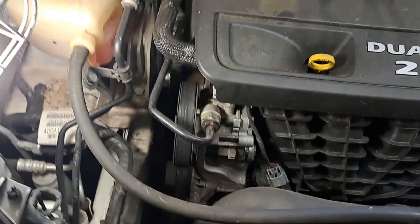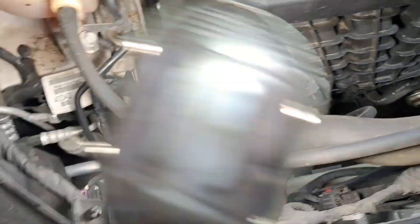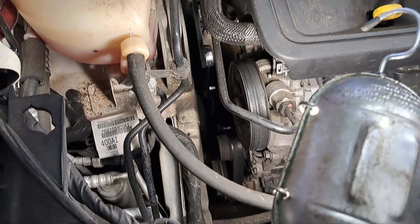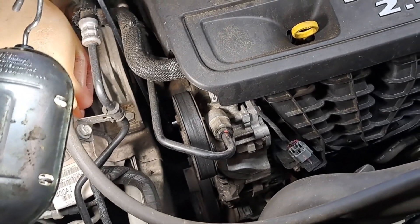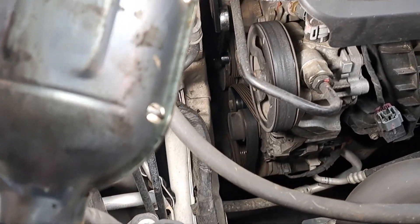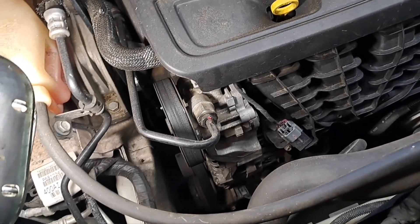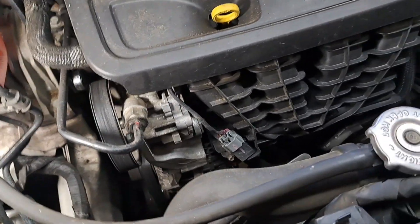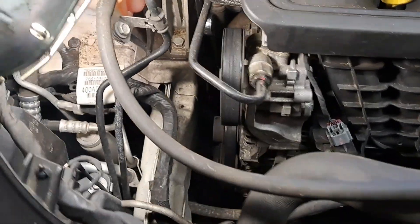By the way, this is a four-cylinder 2.4-liter. There it is, right down in the middle toward the front. It's got a tensioner that holds the serpentine belt, and yes, the serpentine belt needs changing. However, I know my customers very well — I'm going to just put the alternator on because there are no cracks in the belt yet. I'll tell them about it, but they want to fix what they brought it in for.